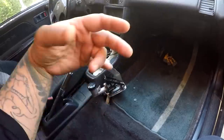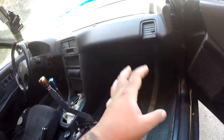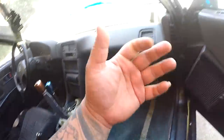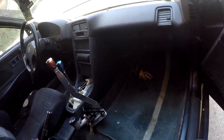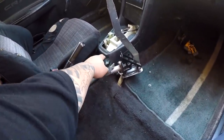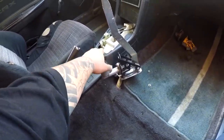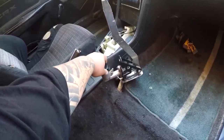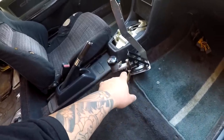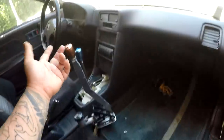I didn't do anything yesterday and thought about pretty much what I wanted to do as far as the line goes, and I was like, okay, well, I watch SP Tuning. I'll run from the prop valve to this and then this to the rear so we can still retain all four brakes. And then I realized, after going back and editing my video, I can't, because I forgot that I have a Wilwood unit which has its own reservoir and only one outlet instead of one in, one out. So if I wanted to keep fluid pressure all the way across four brakes, I would have to swap this over to a two port or a stock clutch master or something.